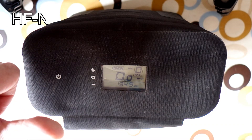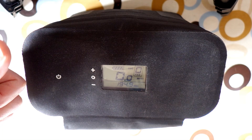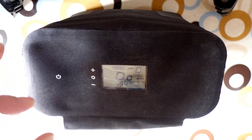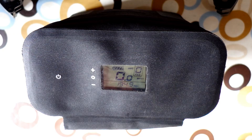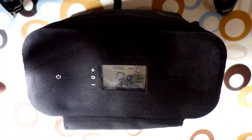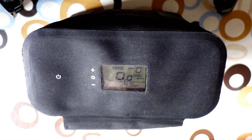If you're going like this, halfway would be maybe half speed — 10 miles an hour — maximum would be 19 and a half. But because it's quite a fine control and there's no indication on the throttle itself as to how much power it's using, you could end up going up a hill, putting it to max, and basically making the battery work harder than it should.